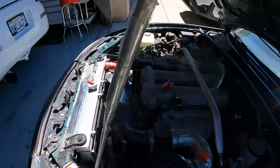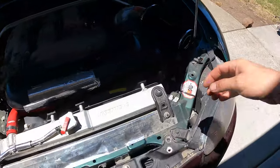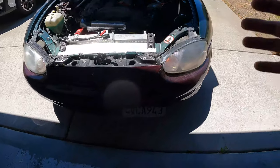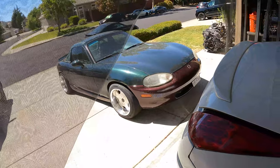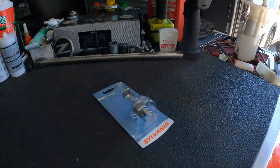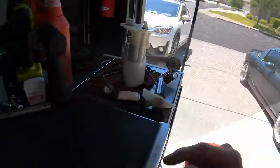Getting stumped on this. I don't know if maybe going back to a factory bulb would help to test if the ballasts went bad. These are like old school HID setups with two connectors — I used to have them back in my Honda days and they would go out pretty frequently, so it's possible that's the issue. I'm going to keep digging. I went and got some basic halogen bulbs just to try — I'm going to completely take out the HID stuff and see if plugging into the factory harness makes them work. That way we can tell if the ballasts were bad or if the factory wiring harness is going bad.